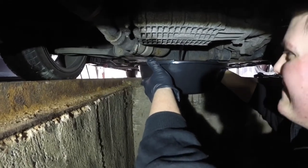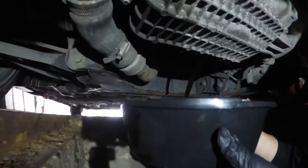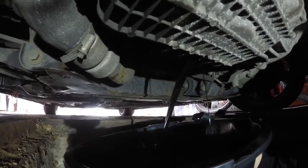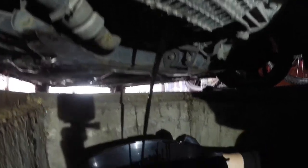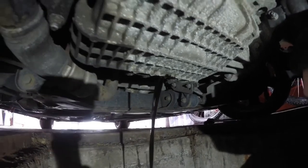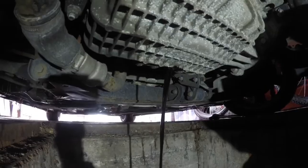It was a bit warm. I'm going to need to go to Euro Car Parts — that rubber washer just broke. So we forgot something: the sump plug, the little rubber seal that goes around it, it disintegrated. So I've just sent my mate to Euro Car Parts while I stand down here in the pit and make sure this oil drains alright. They didn't have just the seals — of course they didn't — they had the full kit though, that was £4.50 or something daft, so sent him round for one of them. We'll get that on.